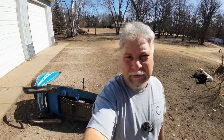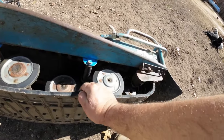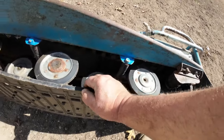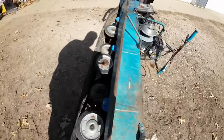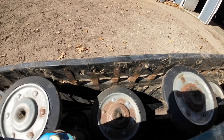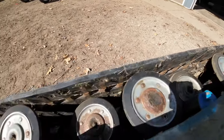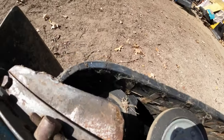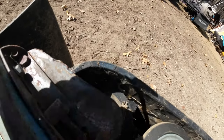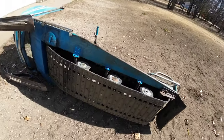I'm out here trying to figure out my track options for this Snow Jet. First I'll show you why I'm trying to figure out options. This track has seen its better days — it's got all kinds of tears coming in from the edge basically at every spot. If I flip around to this side, you can see there are these metal bars inside the track, and a lot of the clips are missing and coming off. It generally looks pretty rotten. There's a good crack right there that would start to tear in from the edge pretty quick — yeah, that already is. I don't think this track would go 20 miles.